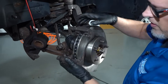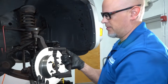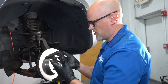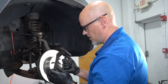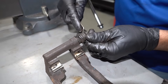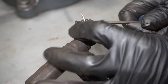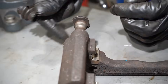When you're going down the road and you have something like this, you're gonna notice a lot of brake smell. It's gonna smell like something's burning — you may even see some smoke pouring out at that wheel — because it's just gonna keep those brake pads sitting on the rotor permanently. So let's fix this up. See if we can get this boot off — just take a pick. It's ripped anyway, so you can just rip it more and slide it off.